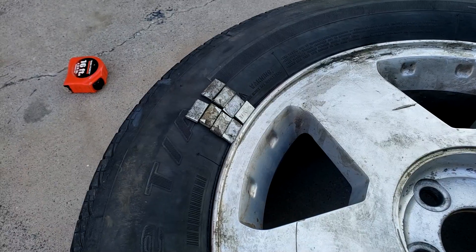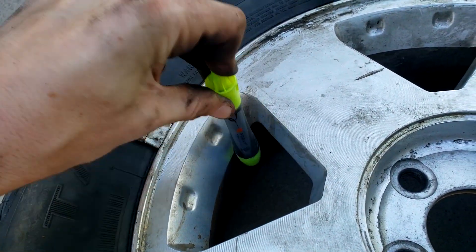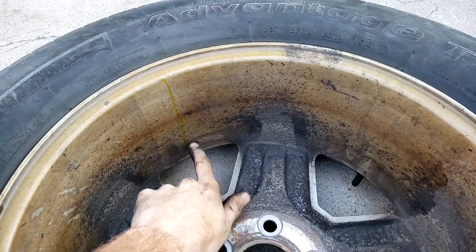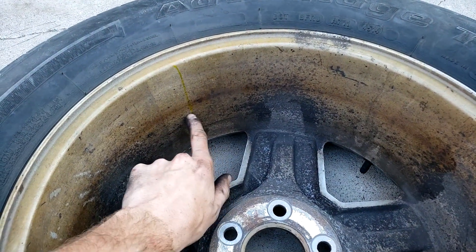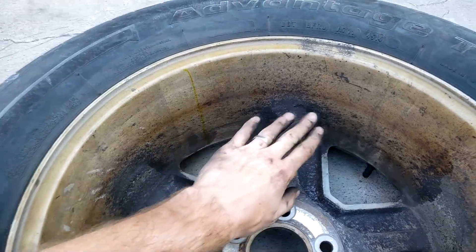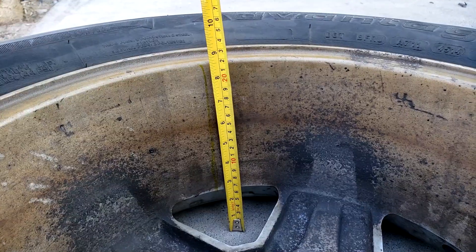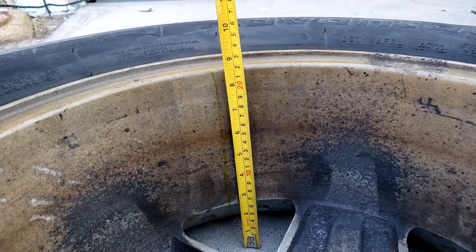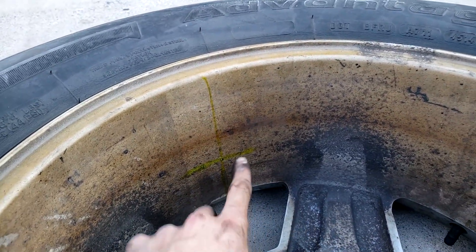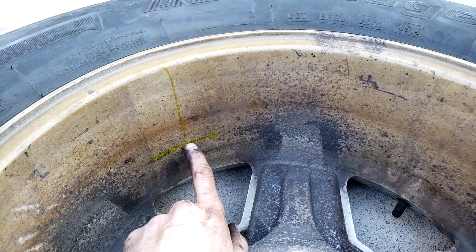Now I know where the weight needs to be applied right here. I'm going to draw a line here so I can reference this when I flip the tire over. I flip the wheel over and I've drawn my line where the weights need to be applied. This line represents the center of where the weights are — the weights will come out here and also here. We're going to put them in the middle of the wheel. We need to measure from the ground to the very top, divide by two, and draw a line across. The center of the rim looks deceptively low, but this is indeed the center of the wheel measuring from the floor. This is where the center of all our weights is going to be.